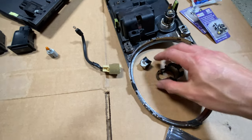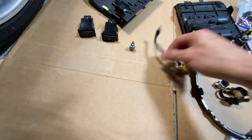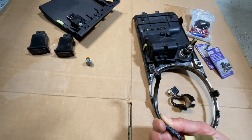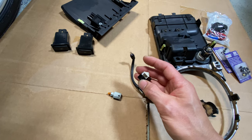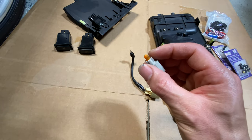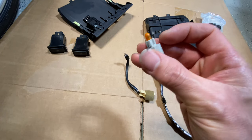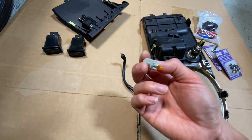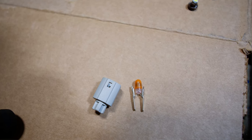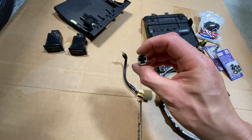We got this stuff all out of the car now. My cigarette lighter is all busted up — all the clips and everything — so I'm just going to go ahead and remove that. I got to open that hole a little bit bigger to fit this new USB socket that I bought. This thing popped out of the ashtray — it's a regular 74 bulb that we're going to change out. This is the original bulb socket for the cigarette lighter. It is a 74 bulb but it's weird because it's actually soldered in — there are two pins that go through there. You can see those two little nubs sticking out — they're metal pins that go straight through. The easiest way is to just pull those out with some needle nose pliers. There are two little compression clips on the side — pull that bulb out and then you can rig a 74 bulb in there and make the connections to those little pins to make it work.